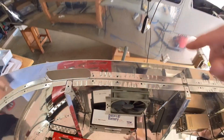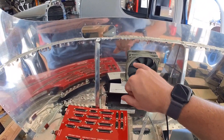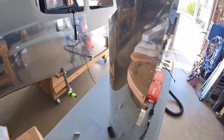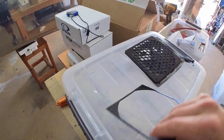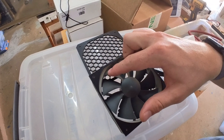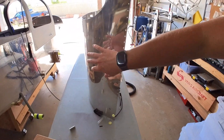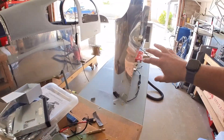I'm not going to center it — I think it makes most sense to favor to that side, as when you look down from the top this side is much more flat, and as you go further to the sides it rounds quite a bit more. I think that's a good happy medium. My plan is to match drill two holes and then go to the back side. I made a grill and a cutout template — I took the measurements directly from Noctua's website for the hole placement. This will allow me to make my perfect cut in the top of the skin and verify my holes are in the right location. I contacted Vans Builder Support and he gave me the go-ahead to poke holes in there for these avionics fans — he mentioned this is not a primary structure and it's fine to do this without a doubler.